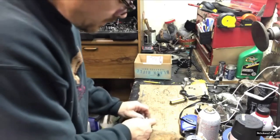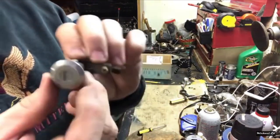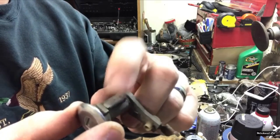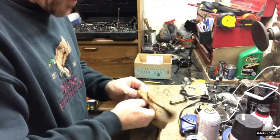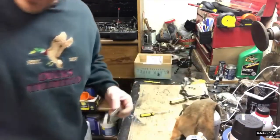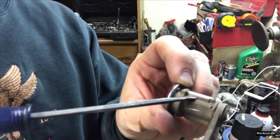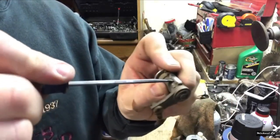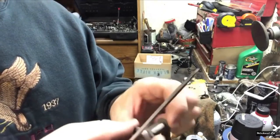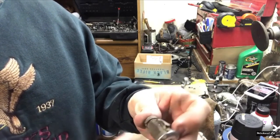On the key set, if you look closely, they have little flat sides on them, but one side is shinier — it's got a little cover on it, and that's the side you need to remove. Looking carefully, you can see there's a little groove there, and there's one on the other side. Come in and pry on that until it loosens up. I had to use a slightly bigger screwdriver — there it goes, that popped up.